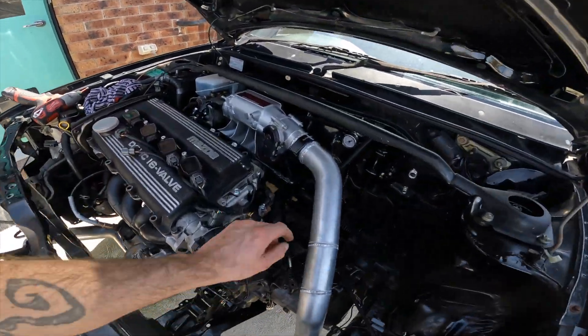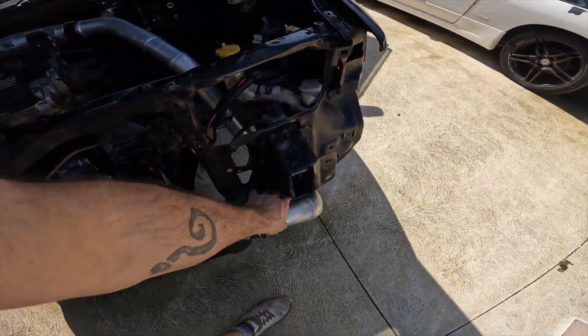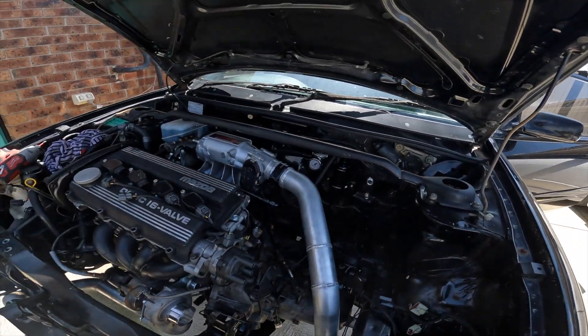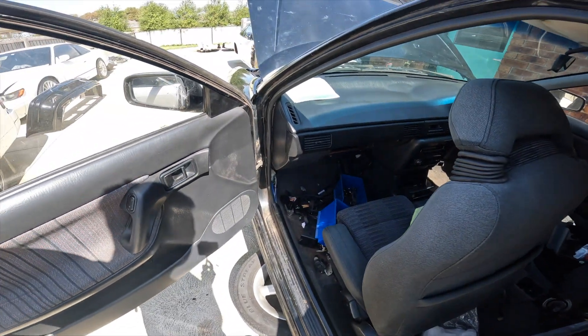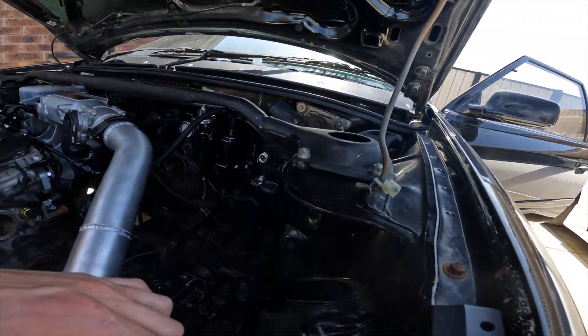Just too tired for this, so I'll walk away and spend a minute tightening up all the fuel lines — not 100% sure all the compression fittings are tight but I feel like they're right. Got one intercooler pipe on properly; the other side unfortunately has to get fixed as it doesn't sit straight — a rookie mistake, first time working with these clamps. Got to pop the coil packs out and put the new stalks on. Fuel pump is in, just have to attach the lines. Got to install the ECU and give it ignition.